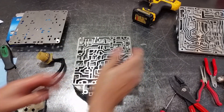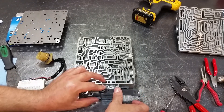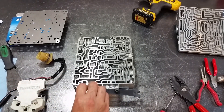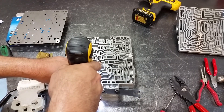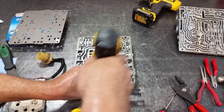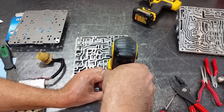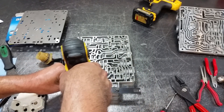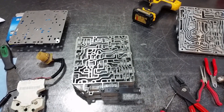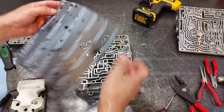You can see that this plug doesn't interfere with anything — the gasket clears it on both ends. Lay down our main valve body, pass it through the guide pins, flip it over, install the detent roller and the other bolt. We are guided. We're going to torque them in a minute.